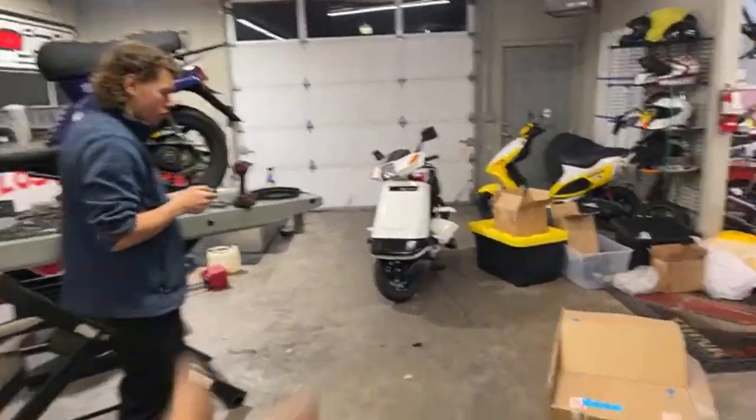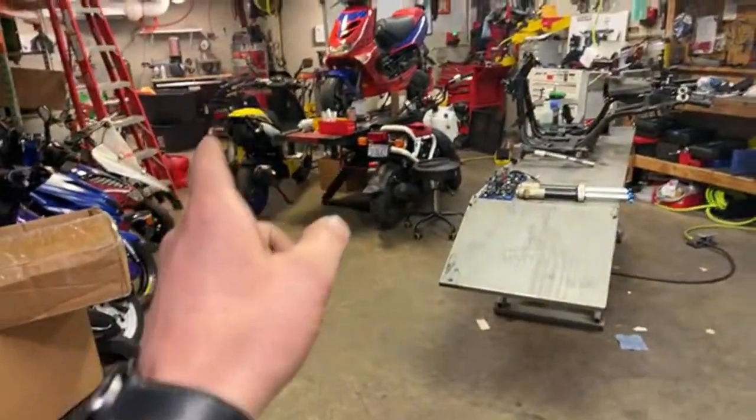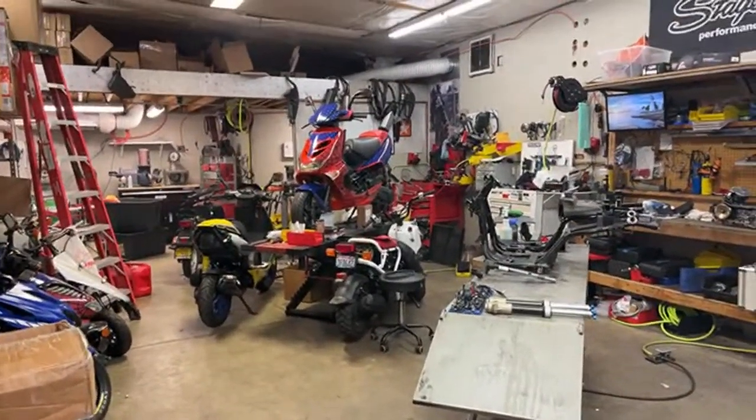It was like five on the street, but it should be closer to 8 or 10. That's just the variator. So we're waiting on a starter. Paul ordered one for that bike for the CH80 so we could test it with the cam. I would be surprised if that bike didn't do 60 with the cam and the carb and the variator.